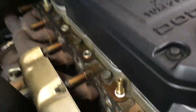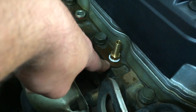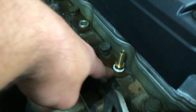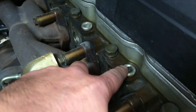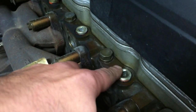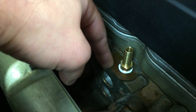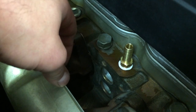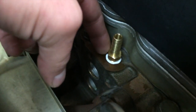Here's the first correction - I said this fitting wasn't right, but it is right, it's the right size. There's a small little factory pipe plug right here. Initially I was looking at the big one over here, but you leave those two intact - you don't mess with those. I popped this little pipe plug out; it takes a quarter-inch Allen head and comes right out. Screw the new one in using more of that Loctite thread sealant and we're good to go.